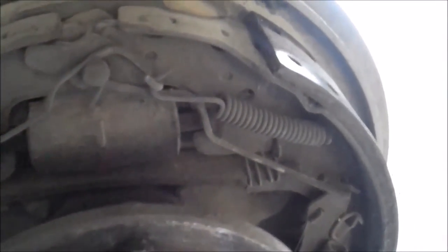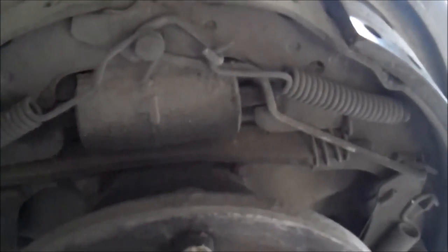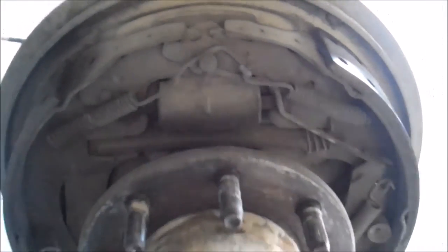So if you're having a problem with your brake pedal fading once in a while, not all the time, maybe you need to take a closer look at your wheel cylinders. You might find they're leaking inside but haven't quite leaked outside where you can see it. You need to pull the rubber boot back if you can. Hope this helps for those brake pedal fade problems.